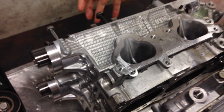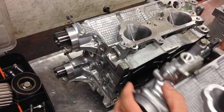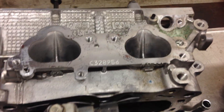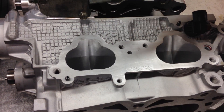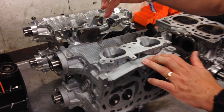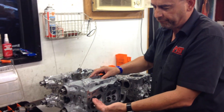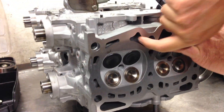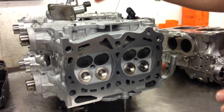Remembering this is the side of the engine that has got the rocker cover assembly, the camshafts, pulleys on the front with the timing belt, and this part here is what bolts up to the top of the head — this is the combustion chamber with the spark plug. If you compare the size of that port to the fully ported head, which represents the maximum amount of material you can reliably remove without either weakening the design of the head or risking leakage. The limitation in here is not just the mechanical components of the valves operating, but also the water jacket within here. If you take too much material out, you end up breaking through the casting into the water jacket assembly, and that causes a whole heap of other painful nightmares.